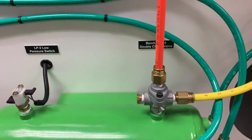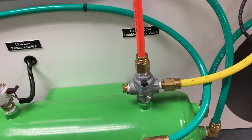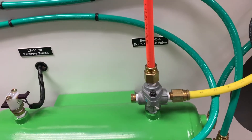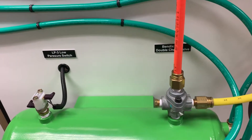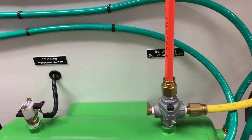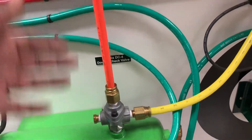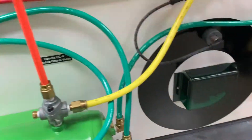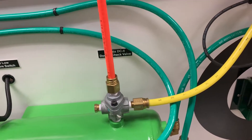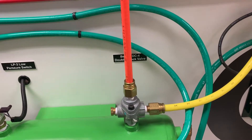Basically, you have a piston located inside of this valve — a piston or a puck. I think of it as like a hockey puck that floats up or down. Right now it will be in an equalized state, which is going to allow air to mix from both of these tanks and then go into our parking brake relay valve.